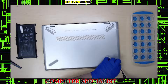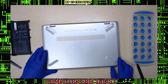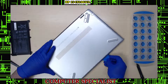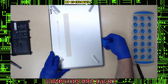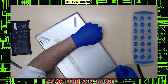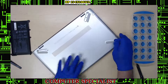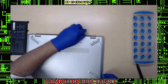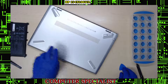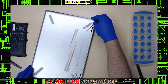We got it out. Now at this point you're going to keep the screen shut — you want the screen closed the entire time. Grab your pry pick and basically run around the edges. Once you get a part up a little bit, it helps to put a little pressure there. Try to refrain from opening the laptop — you don't want to move the hinges. Once it's up enough you can wiggle it, and if you feel a spot that seems tight, get the pick in there.